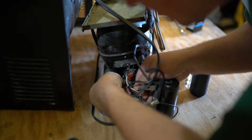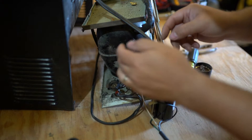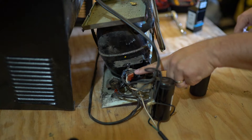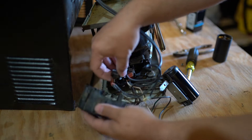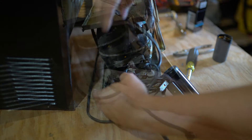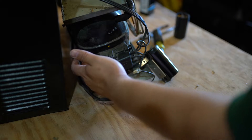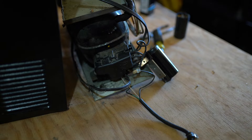Reconnecting the wiring — this wire was on the bottom of the relay, the non-taped one, and that's back on. This one was on the other side of the relay. It's kind of like a cheap terminal block they put on here and all these are the same connection. The overload sits right here, pushing on this. It measures two things: it measures the heat from the compressor, and it also measures the current going through the wire. If that gets too hot from trying to start the compressor, it'll trip the overload too.